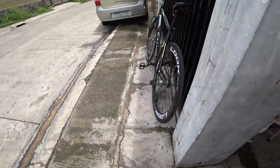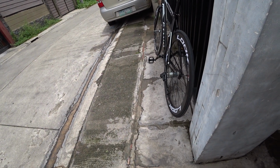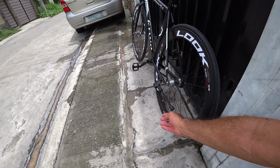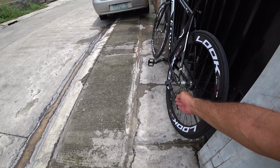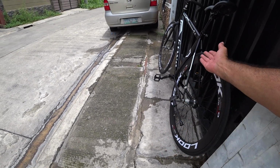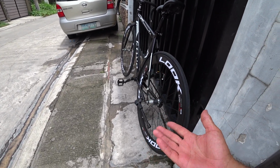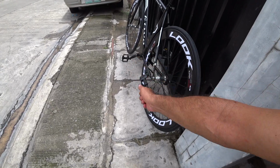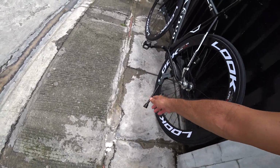The other thing was that stupid kickstand. They didn't have it adjusted. This angle right here was straight up and down, and I bent it out with a big crescent wrench. So when you put the kickstand down, the bike would fall over the other way. They missed the boat on that. So I had to get a big crescent wrench in there and torque it up.